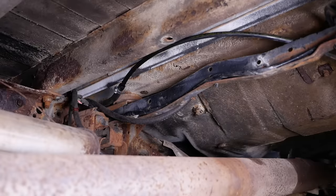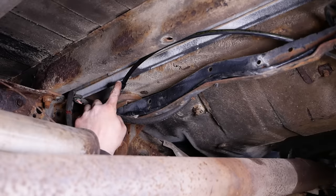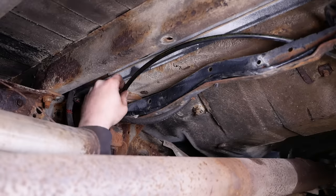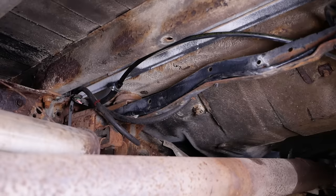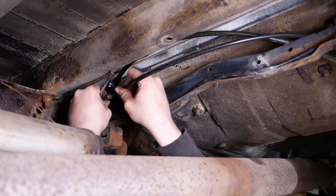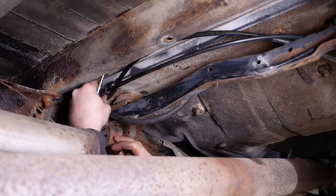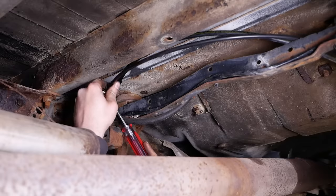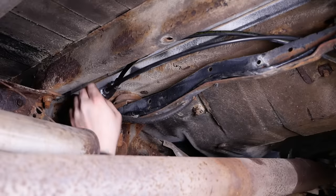Kind of weird because the plastic 3/8 line is 3/8 outside diameter and the rubber 3/8 fuel line is 3/8 inside diameter. So I thought the barb would fit better inside that rubber hose. That's okay. See, that quarter inch fits a lot better. Yeah, that's how it should fit. There we go.